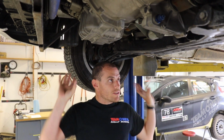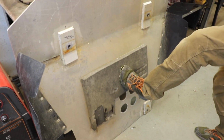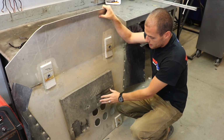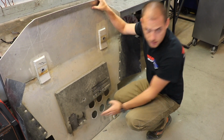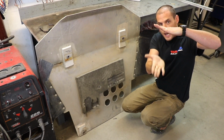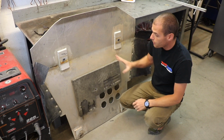So if you have a skid plate made, or you build one yourself, or whatever you decide to do, you steal a road sign and bolt it underneath your Subaru, this piece of foam or a similar piece of foam is really very, very nice to have, because the oil pan, you can see, smushes right here just a little bit. This is that mount, and looks like the transmission case a little right there, but this keeps a rock from getting in between the skid plate and the oil pan, and then when you take an impact, you put a hole in the oil pan and your day's over, even though you've done all this stuff.